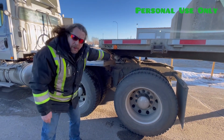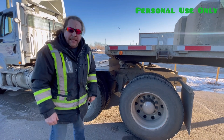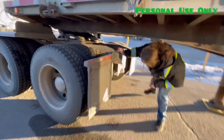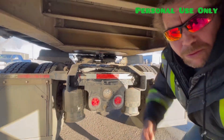I'm going to check here. I want to make sure the trailer touches the bottom half of the fifth wheel so I don't go underneath and miss it. I will come in here and make sure my pin is within 10 centimeters of the middle of the fifth wheel, which it is.